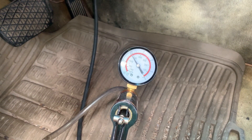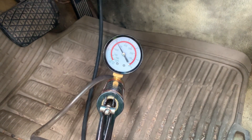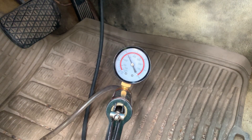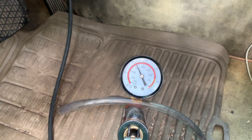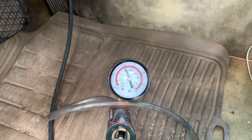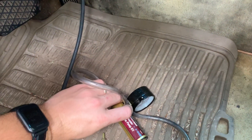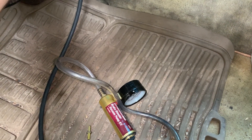Look at that — it's holding. So we've got an issue with that vacuum line somewhere. It's slowly seeping down, but that could be my pump. It's definitely holding better than it was, so that was a good example of one that could have a bad plastic line. The rubber fittings themselves looked okay, but that doesn't mean they are. Let's pull this off and go over to the passenger side and test the other two.